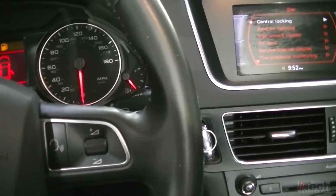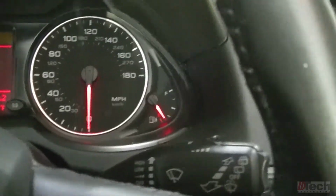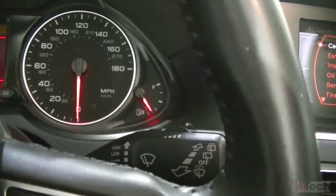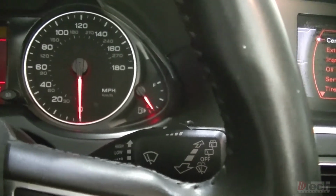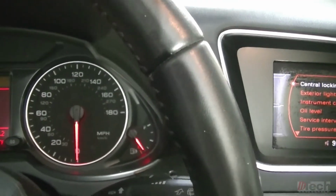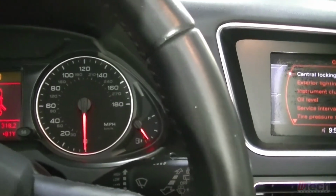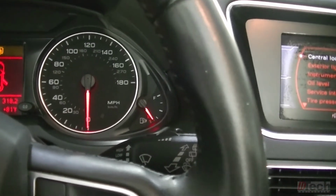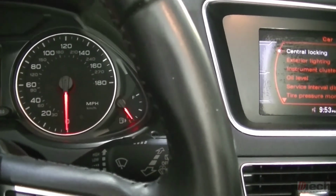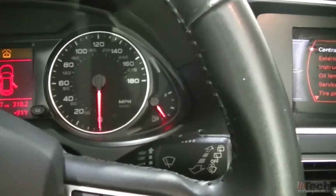We know we have at least 2.5 gallons, which will put you theoretically just outside or right at the starting point of the reserve, which right now needle is shown just below or inside the reserve. Once that needle goes all the way to the bottomed out, the car's gasoline content is still going to have some in it, but if you're driving it at that point with the needle pegged down, you're obviously already gambling. And the important thing is that it's not going to stall with the needle still above and outside the reserve, which it would have done. Like when we first started, the needle would rise up above outside the reserve even though the tank was physically empty. So I'm personally okay with that.